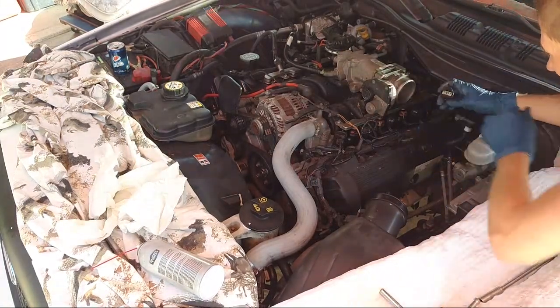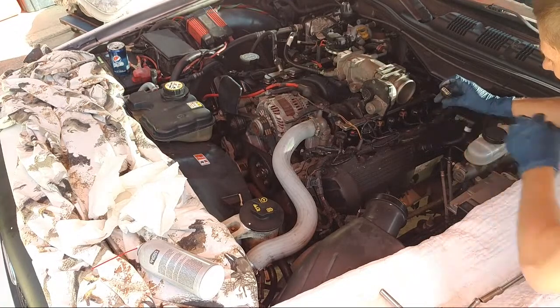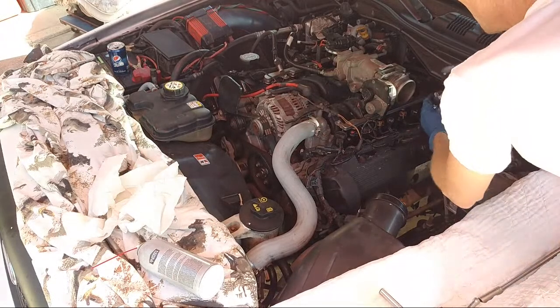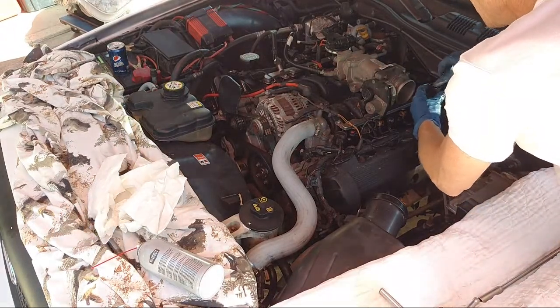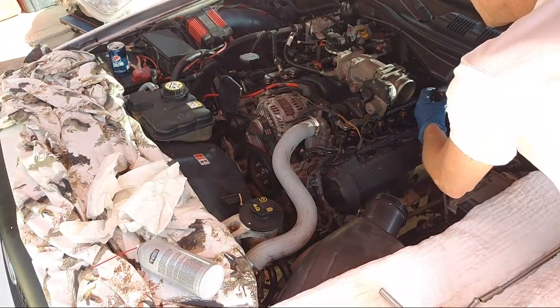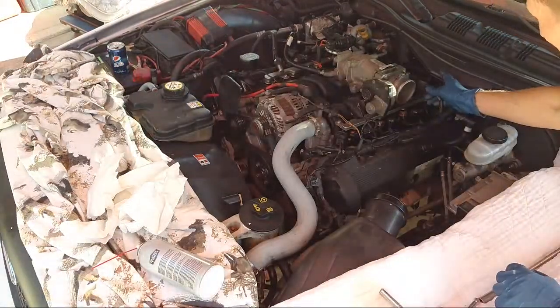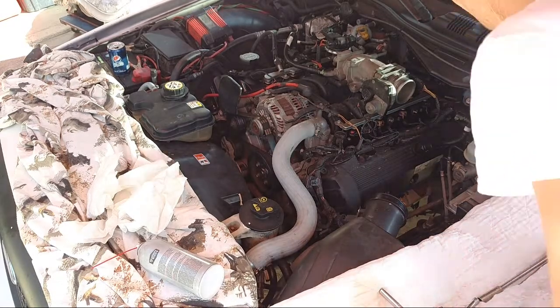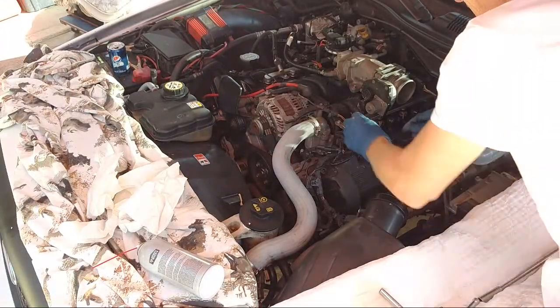And we'll plug our electrical connector in. Make sure we got dielectric grease. We'll put a new little bit in there. Smear it a little bit right across the top, right into the connection. Pop it on there. Nice and done there. Woo! Loving it. We're just about done. Okay, looking good. Everything connected.